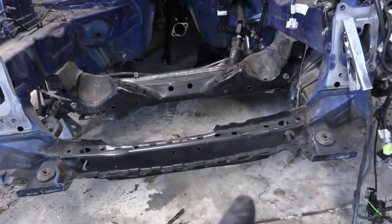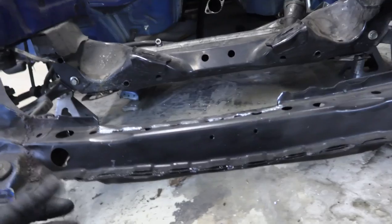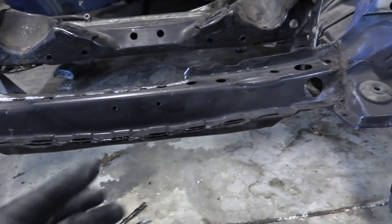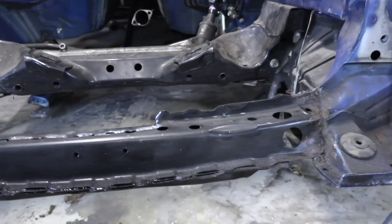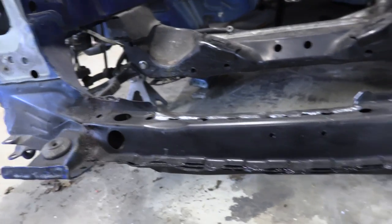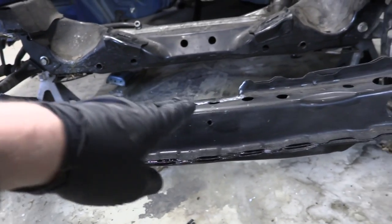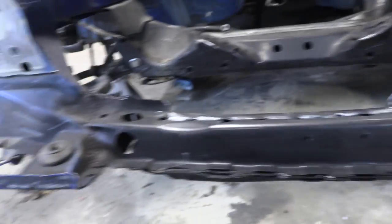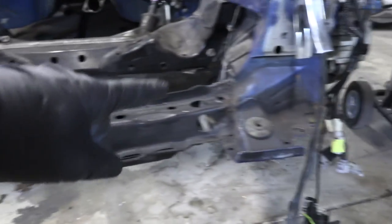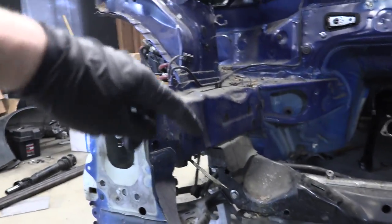Okay, that's taken care of. You can see how I just lowered that down a little bit. This is all built by just smooshing pieces of metal together and pinch welding everywhere, so this weld is going to be much stronger than what they've done. I then welded the two pieces together on the pinch point. If I need more room I could just grab a mallet and bend this down a little bit without ruining too much structural integrity. The welds are pretty messy on the sides, so I'm going to clean those up and then cut out pieces to support the inside of the frame rails.